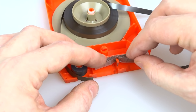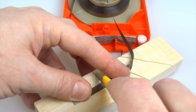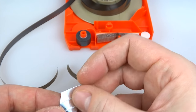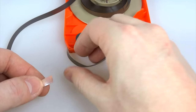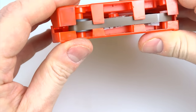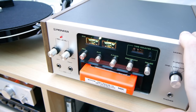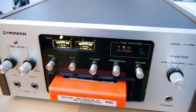The sponge is repaired, but obviously that's not why we opened the cartridge — we're repairing the tape break. First cut out the bit with the old metal splice, leaving two clean pieces of tape. We're not deleting any recording — there's always a gap of silence around the splice. The kit supplies sticky-backed metallic strips which hold both pieces of tape together — and it's as good as new. Put the tape back inside the cartridge, make sure it's nice and tight, and put the cartridge back together. Let's try it out and see how it gets past the new splice.